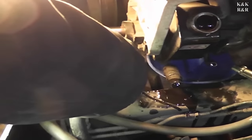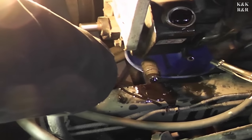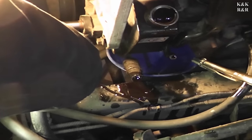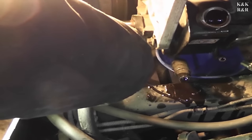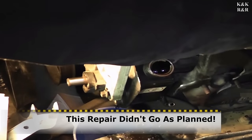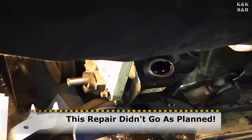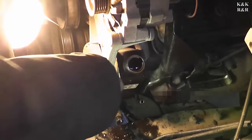Get as much of the fluid into a catch pan as you can so you can inspect it. Make sure there's no shrapnel that got sent down into the steering box, because that happens. If it does, you're going to be chasing a steering box, and I'm not a guy who can rebuild one of those. One bolt is holding it together — two, actually. I did put one back in the alternator just so I had some leverage once I found out that fitting had seized. I'll show you that when I get the pump out. Undo your hose connection first, get that dealt with, then undo your pump.